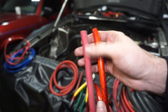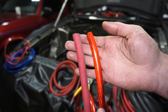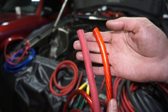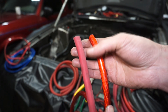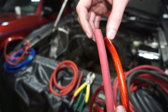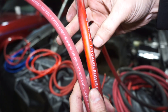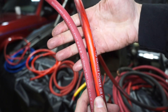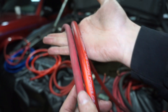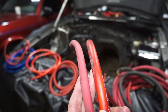So if you're worried about space and this was your size limitation, you'd want to go with the copper one because you'd be able to carry more load safely. Some of it may come down to physical space — you may not really care how big the wire is and just want to get it cheaper. But if size is an issue, you'd want to get the max current load you can, so you could get the copper wire and then not worry about the size limitation. Now let's look at this 1-0 welding cable compared to the physical size of this 1-0 CCA wire — the CCA is actually a lot bigger in diameter, so the smaller wire will be able to carry more load.